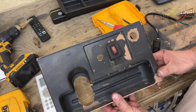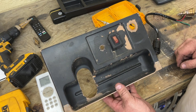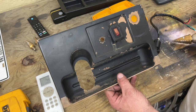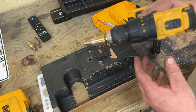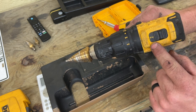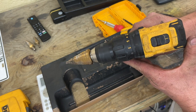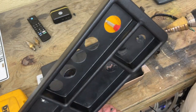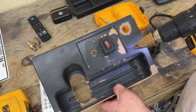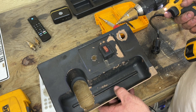I have an old Club Car DS dash here to test fit it. This factory dash is a lot thicker than aftermarket stereo dashes, so be very wary of how you drill. Setting two is fast, setting one is slow. I like to drill very slowly, especially on thin dashes. On thicker material you could get away with a little faster, but take your time — you really don't want to mess this up. I'm going to go ahead and drill this one hole out to the right size.